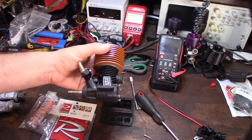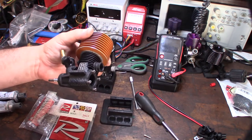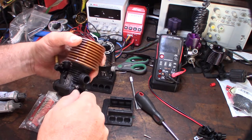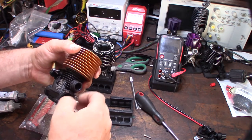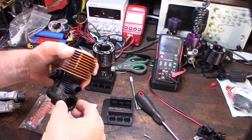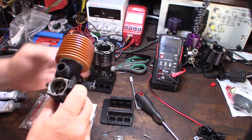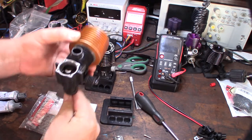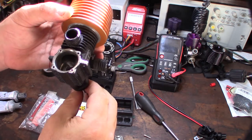For example, when I first bought these engines in a different video, these things were covered in orange RTV sealant. And that's a horrible thing to do because RTVs — you're basically asking it to destroy your engine. What happens is when you get RTV, sometimes the RTV comes off and it will get caught in your connecting rod. You could damage your bearing. And actually the biggest problem with RTV is that, like when I first got this engine, there was RTV on the connecting rod.